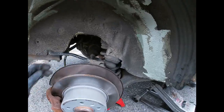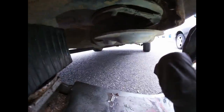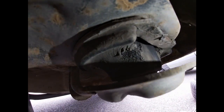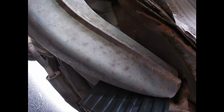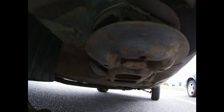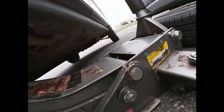I'm going to address all the things, but now a really good thing to check would be the tires. They're a little tired, not that bad. A little bit of cracking there. Then these trailing arm bushings. Need to check that other one as well. This doesn't seem too bad. Just a little bit of cracking, not much. Considering this car is 40 years old, it's amazing.